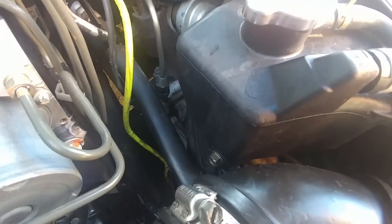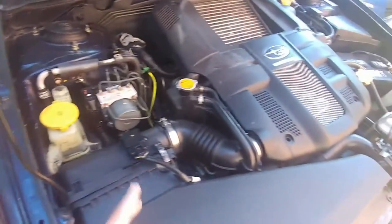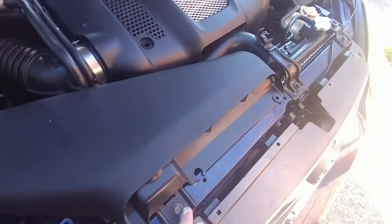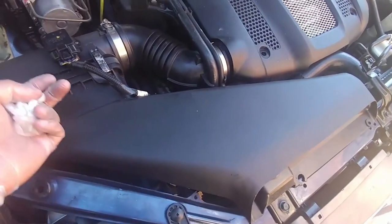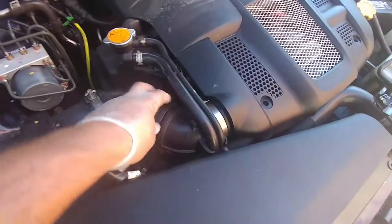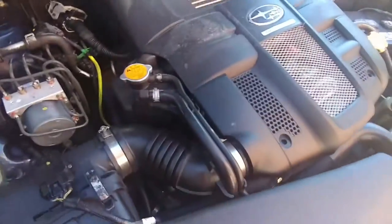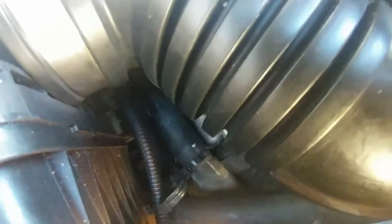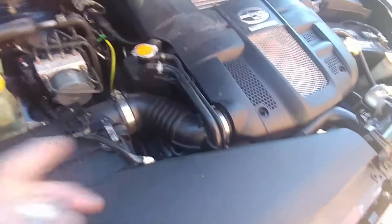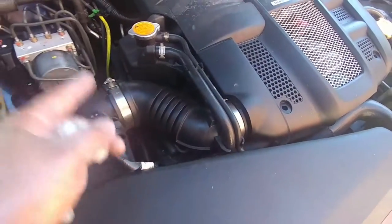There's not a lot of room without lifting the engine. I've read you have to lift the engine - you do, you don't - on a regular Legacy, you do, you don't. Anyway, we're going to start by taking the tire off and getting as much access as possible. Right now we're going to take off the air intake, filter, MAF sensor, air hose, and the cover to get in there. That's the easy part.